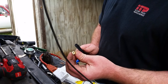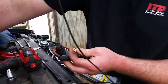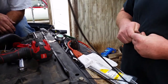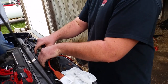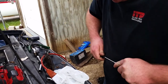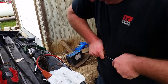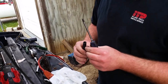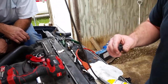We got our restriction which is a fitting for an oil pressure gauge. This is what we used on the wagon. So we're going to start here and then we can monitor it on our gauge to make sure that we've got enough fuel pressure. We're just going to shove this in this hose with a screwdriver — just far enough to get the clamp on. That should slow enough fuel down that we won't build too much pressure but still get pressure to the carburetor.